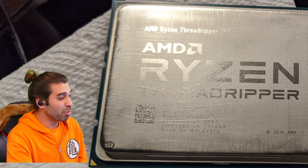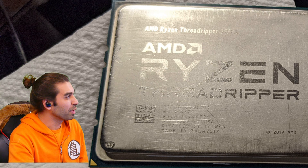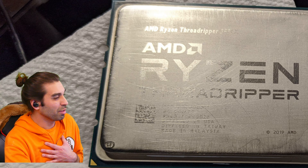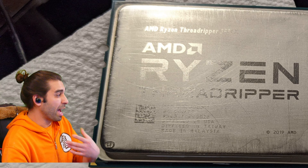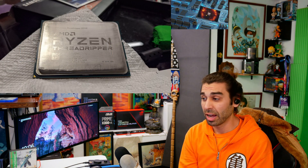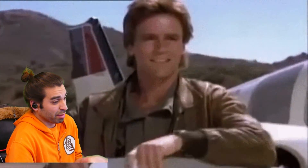I'm not saying this is bad, but if this is something AMD could have fixed, that would be cool if they made good on it. If you're taking apart your 3970x and noticing thermal paste coming out around the stamp area, your CPU might be a little warped there. If you don't want to do what I did, try to get a refund from AMD — but it's still going to run really well. This is only if you're overclocking and you're an enthusiast who wants insane consistency. I followed my MacGyver instinct and emerged victorious — and numbers don't lie, that's literally a beautiful language.